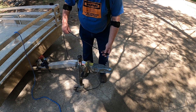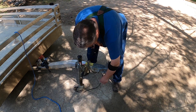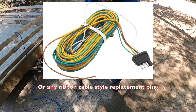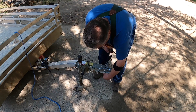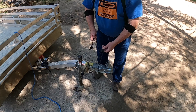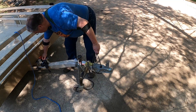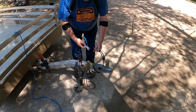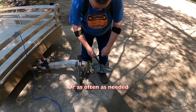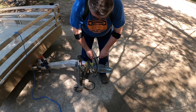The first thing you want to do is make sure you've got a good quality replacement plug. I got this off Amazon — you can get them anywhere. They are not all created equally; I think the Harbor Freight ones are pretty cheesy in comparison. This cord I can't pull out or shove in very well, so this is going to keep happening again and again. From experience, I want to make this cord just a little longer to leave myself room to replace it one more time down the road.